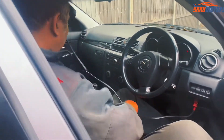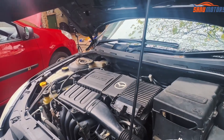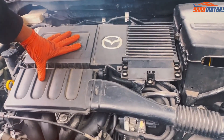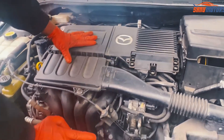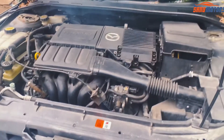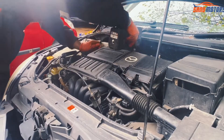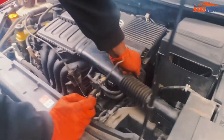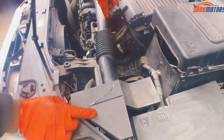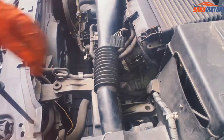I'm going to switch off the car. Underneath this cover is the air filter. All the plugs are under the cover so I have to remove it. This one is held by number 10 bolts — three bolts, I'm going to remove them. After that I need to disconnect this connector, then disconnect this clamp, and after that we can lift up the air box.